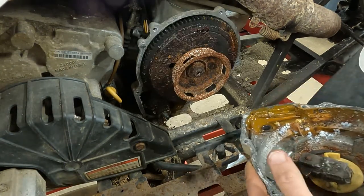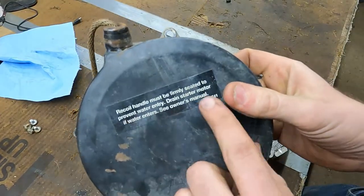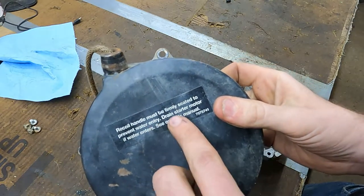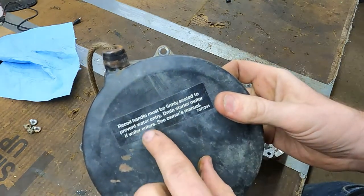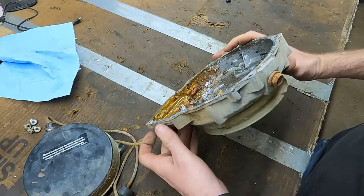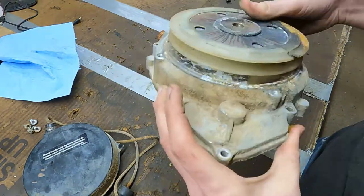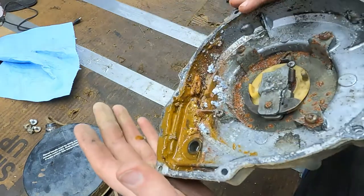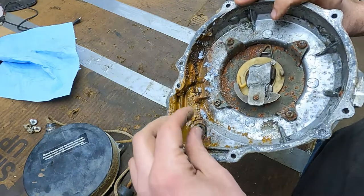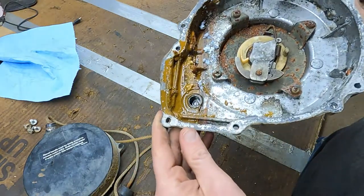No wonder this thing didn't work. That is the reason why we follow this sign: 'Recoil handle must be firmly seated to prevent water entry. Drain starter motor if water enters. See owner's manual.' Because Polaris had a stupid design — if water gets down in the recoil housing, somehow it gets inside this cover. The starter motor and throwout gears are under this cover. So I think I'm going to start by parts washing this.